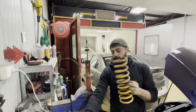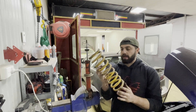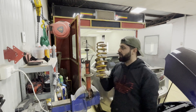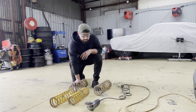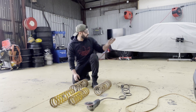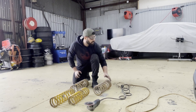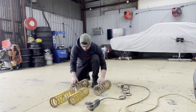Always use spring clamps when you're taking your springs off struts — get the compression off it. If you just release it, it can actually jump if it's got a lot of pressure in it. You can hurt your hands, break fingers, or lose some teeth. Be safe, don't just cut them while they're under compression. I've got my grinder out, I'm wearing safety glasses, I'm in an area where I haven't got stuff around me — sparks hitting glass windows can put marks in them, so work in an open space and wear safety equipment.